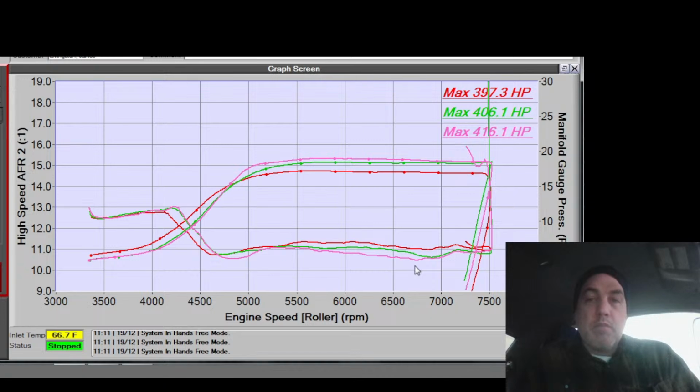Okay. Now, granted, it's cranking really slow, so you have plenty of time for your pulse width to go in. 180 is fine. The intake valve doesn't close for another 40 to 60 degrees anyways, so that's okay. You should be able to get all of your pulse in before the valve shuts in that situation. So that should be okay. 180 would work. Okay, so I did that.